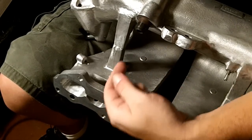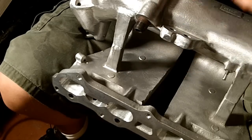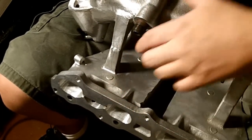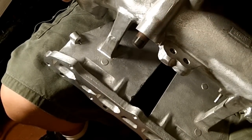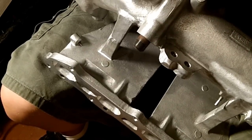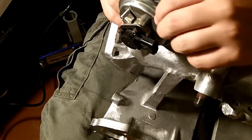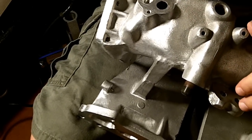Now your EGR gas from your exhaust manifold, or exhaust header if you have an aftermarket eBay header, gets shot all the way around the engine into here. And then it travels through here and kind of makes a 90-degree turn into your EGR, like so. It's hard to see there. It comes through here, gets shot into your EGR, and will make its way back into your intake.